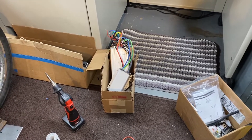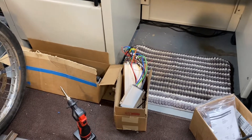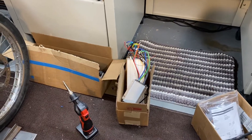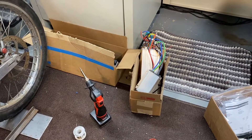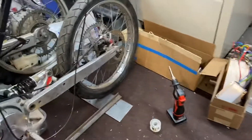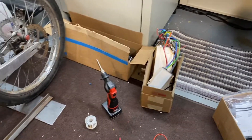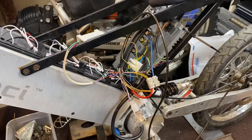I couldn't get it working on the Kelly KBS controller. I read on the forums that if you put 12 volts to the hall sensors it might work, so I put the whole thing back together on 12 volts from the output to the halls — and it still does absolutely nothing. I program it with the program cable, do the auto-identify, it moves the motor a little and cogs like it's finding the configuration, then doesn't do anything with the throttle at all. There's a green light on the Kelly, so I have no clue why it won't spin this motor. I think there's something really weird with the hall sensors.